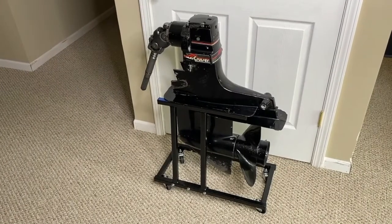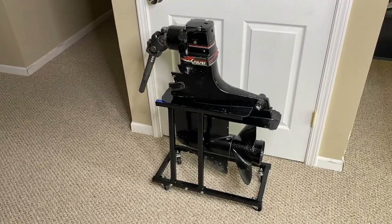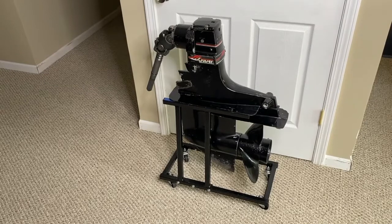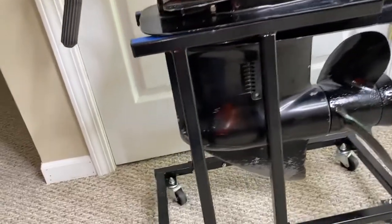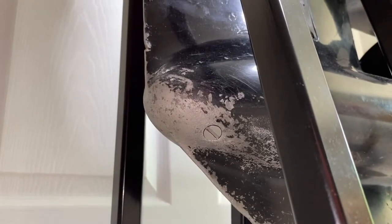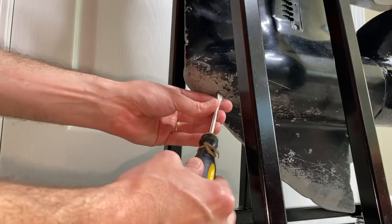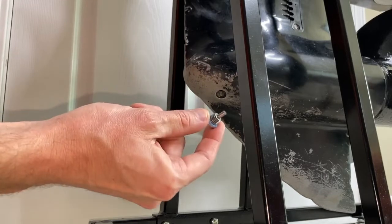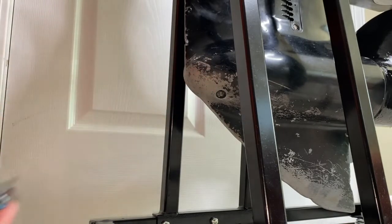I repositioned the outdrive to give better access to the drain port. Our outdrive is completely rebuilt and completely dry — no gear oil in it. If you've recently drained your gear oil, put something underneath to keep the surface clean. Coming to the front and bottom portion of the outdrive, there is the drain port screw. Grab a thick flathead screwdriver and carefully remove it — using a thick tip helps avoid stripping the screw. There's the magnetic portion of the drain screw that attracts any aluminum or metal shavings mixed in with the oil.